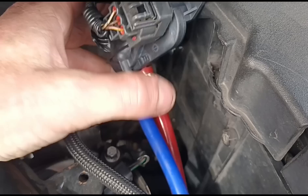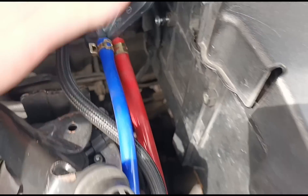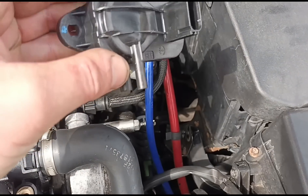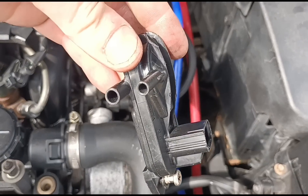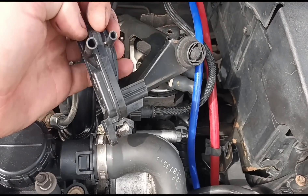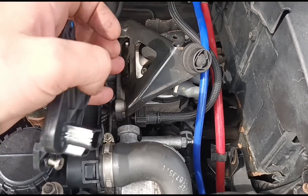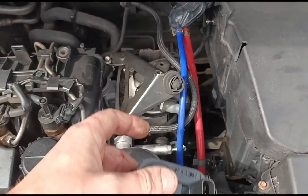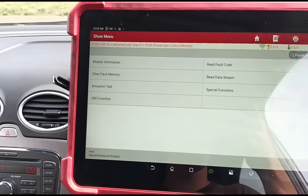We've got that plugged in with both hoses plugged in at the bottom. If you look at the old sensor, one tube is slightly smaller than the other — this is the side that goes before the DPF, and this is the side that goes after. You can see he's already changed the hoses to some bright-colored ones just to identify them.